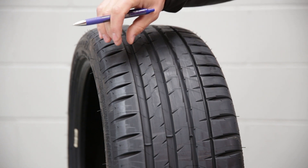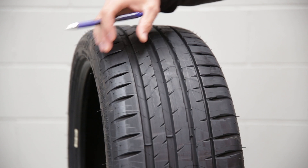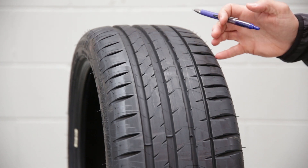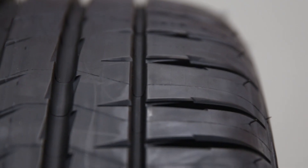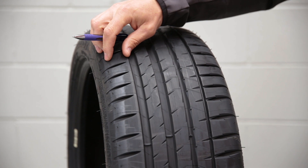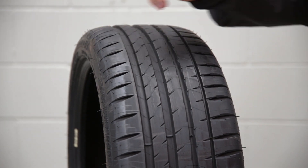One thing you'll notice that's a little bit different between this and perhaps a more sports-oriented tyre is that the shoulders are not as solid as perhaps a more performance-oriented tyre, because again that's trying to get that water out — so it's balancing off between evacuating the water and having the strength here to allow you to corner faster. This perhaps won't let you corner as fast as a more track-oriented tyre, but it's going to be a heck of a lot safer in the wet for regular passenger cars.